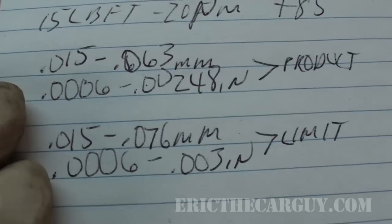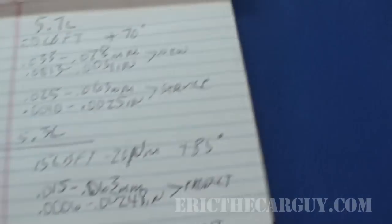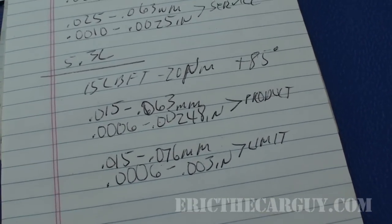I'm going to put links in the description to where I found this information on this engine, as well as the torque specs. Also links to all the tools and PlastiGauge — everything that I've shown in this video. And that's how we measure stuff with PlastiGauge. Is it accurate? Well, it's accurate enough. This might be something you do in assembly, but if you truly want to know what's happening with those clearances you need those precision measuring tools. But PlastiGauge is a heck of a lot better than not doing anything and just throwing something together. If you find yourself needing to put an engine together and you don't have precision measuring tools, PlastiGauge can save your butt — it can put you in the ballpark, and in some cases the ballpark might be good enough.